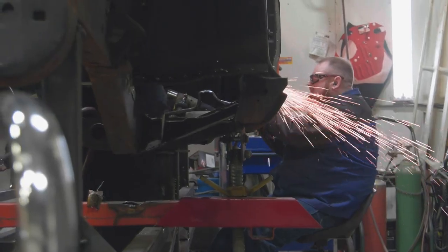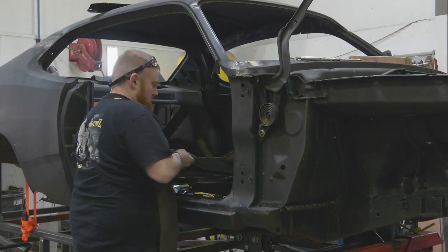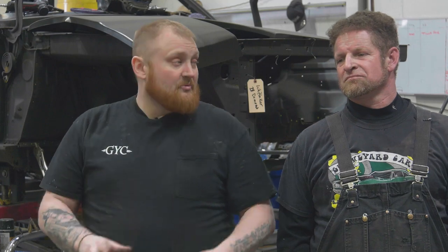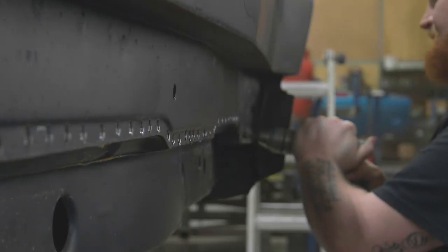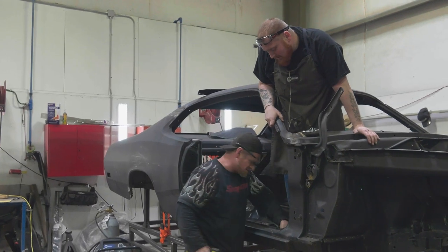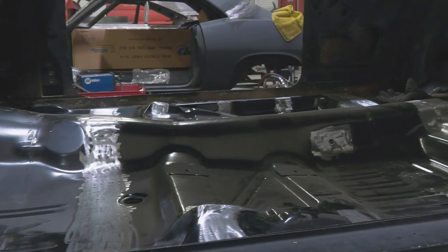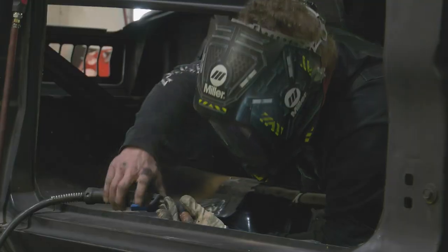Me and Adam have been working on the '71 Demon. We're putting patches in the quarters, replacing the trunk floor, doing the trunk extensions, and putting a brand new floor in. When we were putting the floor in, we ran into a couple of complications. One, the transmission crossmember was all rusted out, but luckily we dug one up. Adam's been doing a terrific job — this is probably one of the better cars Adam's put together. I'm really proud of him. We've got some of the patchwork done. I have the left quarter already patched and I'm working on the wheel tub right now. I had to undrill the rear taillights to free it up so we could pull out the old floor pan and put the new one in. Another complication was our rear seat pan was all rusted out, so we had to put a big patch in. It looks great — it's money. This is Adam's first floor he's done the whole process by himself, and he did a really good job. If everything goes right, we'll be right on schedule.